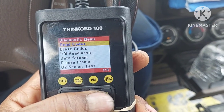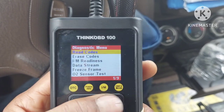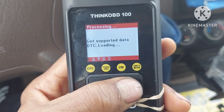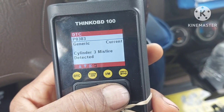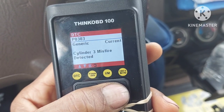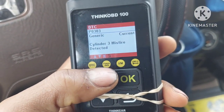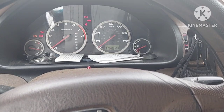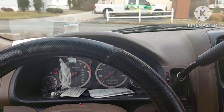I use this scanner like once a week. Every time the check engine light comes on I just clear it and keep driving. I decided to try out this product. The scanner says: misfire on cylinder number three. What I did initially was switch around the plugs and the coil pack — still had the misfire on cylinder number three. I put new coils in, new spark plugs, gapped them — still had misfires on number three, and every now and then it would throw a random misfire.